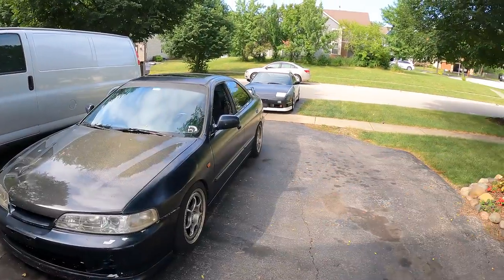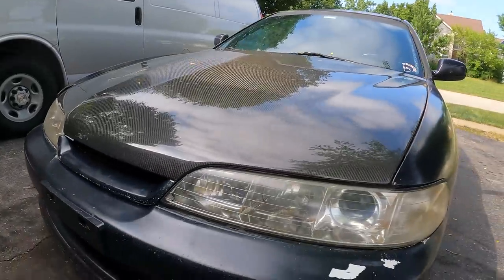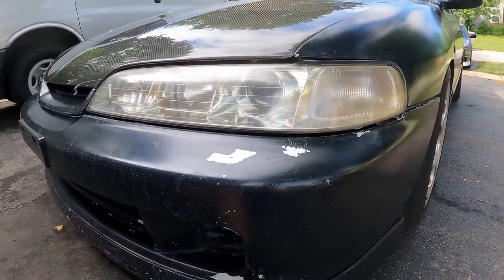I don't know about you guys, but lately it's been super hot and my work truck has no AC because one of the AC lines rubbed through and leaked all the refrigerant out. Don't tell the EPA. But I picked up this line, so let's slap it on. First thing you want to do is take the bumper off. Usually you can start with a good wiggle.